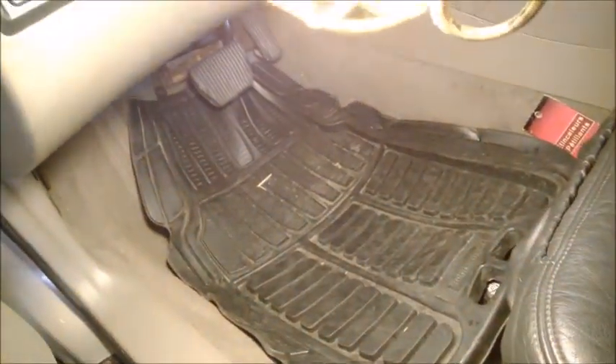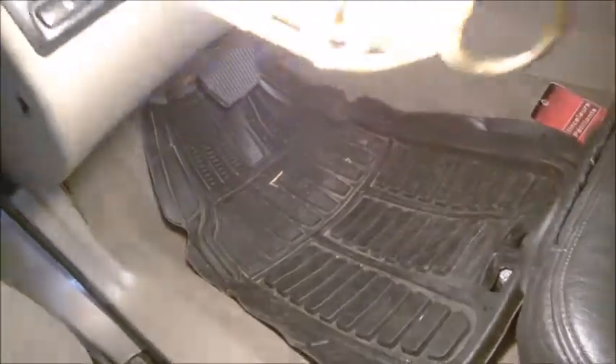You may want to pump the brakes — I used a brick or wood piece to help. You should not depress the brakes more than two or three inches, because when the screw is released you can depress the pedal fully to the bottom, but that will damage the master cylinder. So only two or three inches each time. With the engine off, push maybe four or five times.